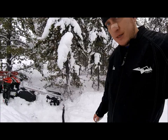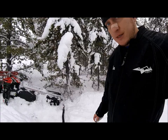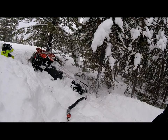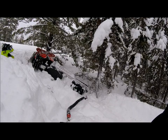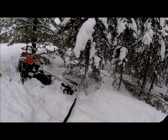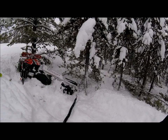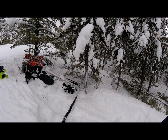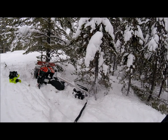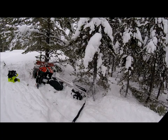Here's my ratcheting rope — got it hooked to the tree. Put the ratchet end on the same side as the bungee so it's out of the tree, and I'm going to go ahead and spring it tight. You can see those bungees getting real tight. When I get this thing fully maxed out I should be able to go down there and with a little bit of effort get that sled to pop out of that hole. My goal is just to set it flat so it has some traction. I may even have to hook up to the front end and drag it out too — a lot of work, but if you're patient you will get it out, especially when you don't have anybody around.